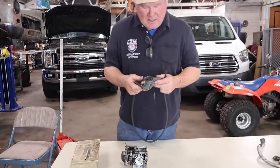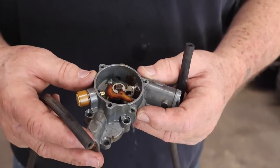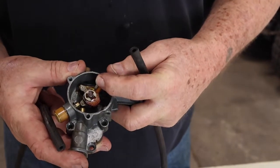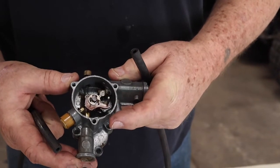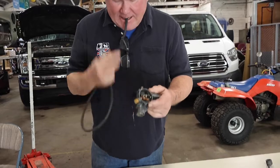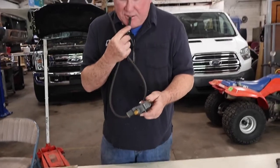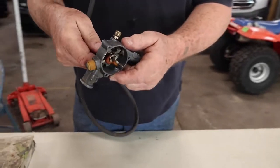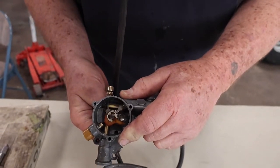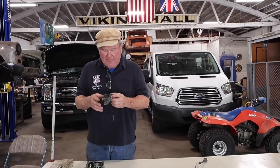The complementary side operates what I call the vacuum kick piston — I'm sure that's not the official name, maybe it's piston comma vacuum kick. Anyway, there's a spring-loaded piston that always pulls the choke on when the car is off. You can check this vacuum piston by putting this in your mouth, drawing a vacuum, and putting it on that hole on the backside. The piston is moving. If it isn't, sometimes they get jammed up, get dirty — you can take it all apart. That's a lot of fun; I've got another video about that.